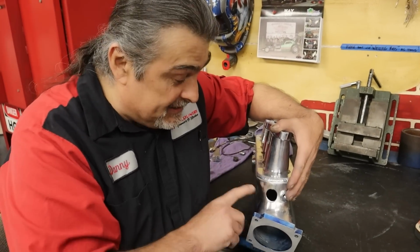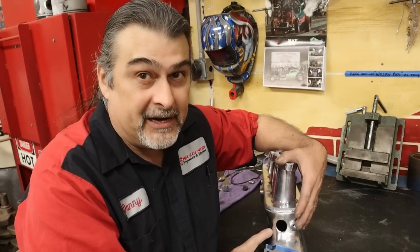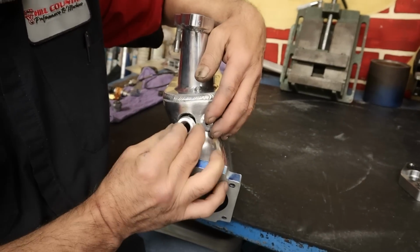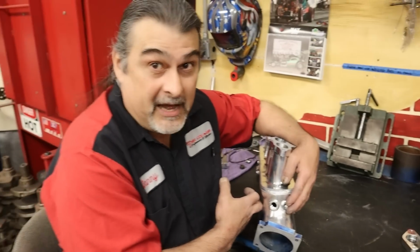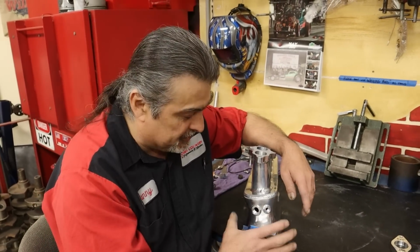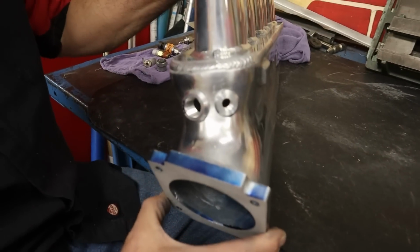Is this aluminum not sheet metal? It's cast aluminum. Yes. It was thick enough that all I had to do was just drill and tap it. It didn't need these bungs because it's not real thin. It's actually thick aluminum. It's really thick, yeah. So this is going to be cool, but this is going over and beyond. On something this thick, you could have just drilled it and tapped it. But that would have just been too easy. Yeah, it wouldn't have looked that cool.